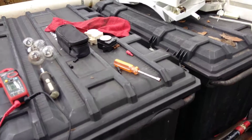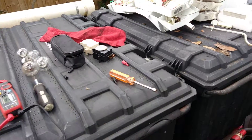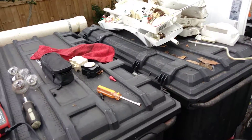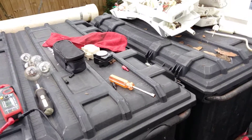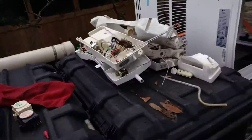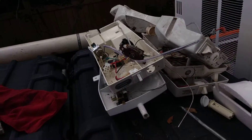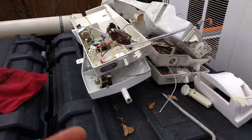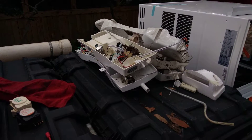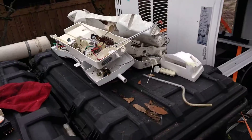Two videos in one day — I wanted to share something real quick that I thought was interesting. I needed a thermostat; I'm working on a refrigerator and the thermostat's no good. I scrap refrigerators — I pick them up off the side of the road. What I usually do is pull this whole unit out in one piece: quick and easy, keeps all the pieces together — your thermostat, your switch, and your defrost timer all on the same thing. So I needed a thermostat today.